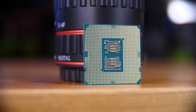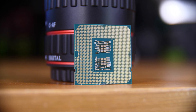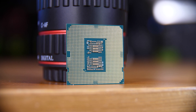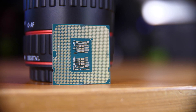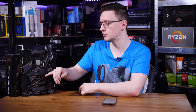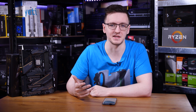What's interesting is that these new pins are currently inactive on these new chips. As I understand it, they're planning on using these extra pins to double the number of PCIe lanes — specifically to support Gen 4 speeds to your M.2 slots and your main graphics card PCIe slots.